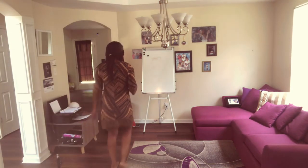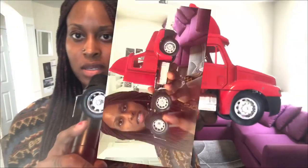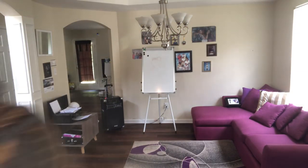Your front drives, let me show y'all. So this is your second set of axles, this is your second set of drives, and this is your first set of drives. When you go on a CAT scale — or even a scale some shippers have, because beer loads are always heavy — when they print out the receipt, it will be broken down in three categories: your front drives, your second drives, and your trailer axles. Your front drives are supposed to be 12,000 pounds and below. Your second drives are supposed to be 34,000 and below. And your trailer axles are supposed to be 34,000 and below.